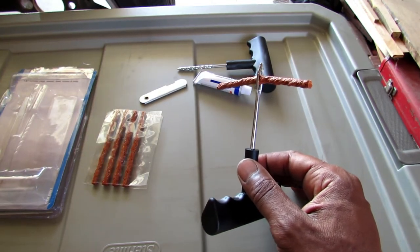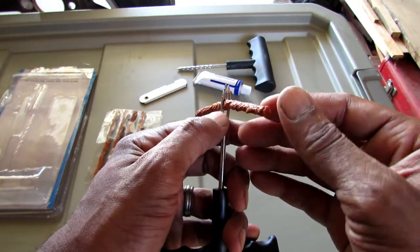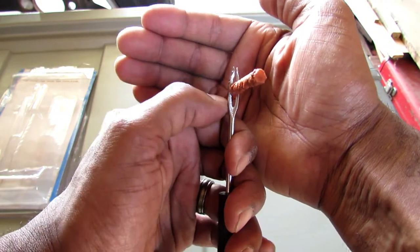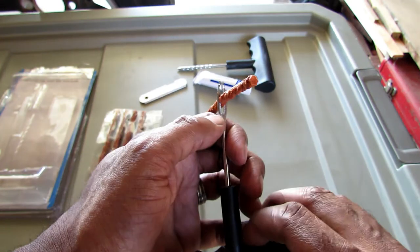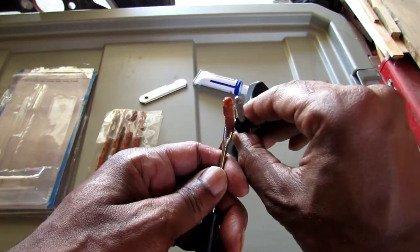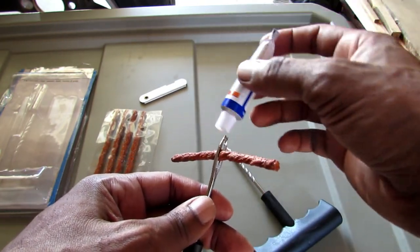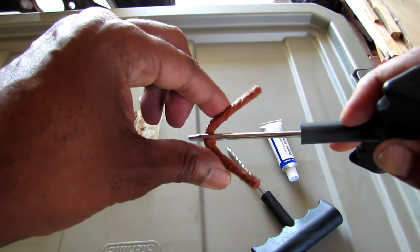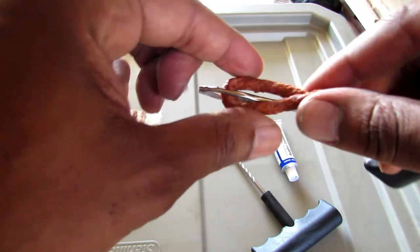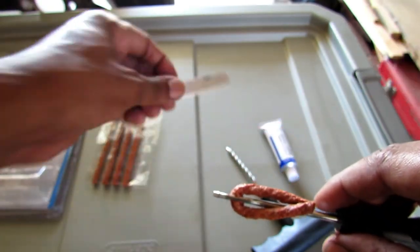So this is the one we're going to repair. It's a good idea to have everything set up so that as soon as you extract the nail, you can just insert the plug. What you do is take your plug and insert it into the hook — just slide it in and then pull it through. Then as soon as you pull the nail, you're going to resize the hole with the reamer. As you can see, the reamer is almost the size of the plug. We're going to put glue over the plugs, and then as soon as you stick the plug in, it goes in like this. You can see the opening on the bottom of the hook — when you pull out, it will pull off of the plug.